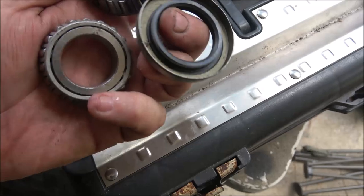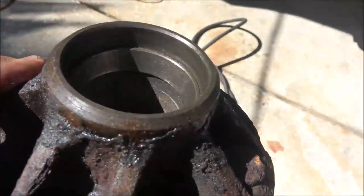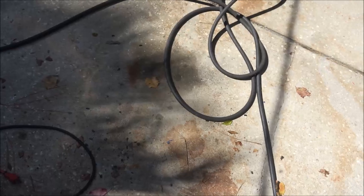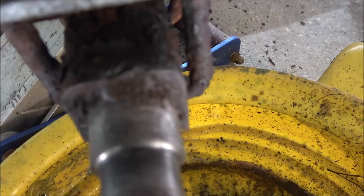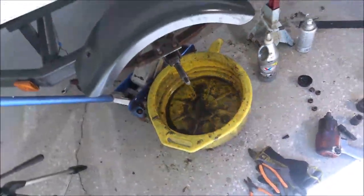Okay, I found them. Now I gotta see if they'll fit. I got the bearings and seal but I don't have the races. That race right there is a little pitted - the front one's okay, the back one's a little pitted. It may still make a little noise. This would not be a permanent fix, but I'm comfortable with it taking it tomorrow. This is where the seal rides - see it's all pitted, so it'll probably leak a little. But I just need it to get us there tomorrow and back on Sunday, and I think it will do that as long as that axle holds out.